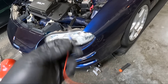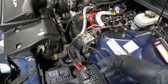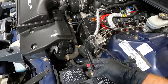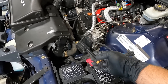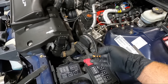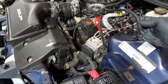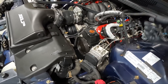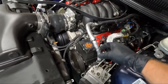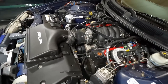We got it soldered back on. Turns out there was a tape joint right there, but anyway it's more sturdy now than it was — soldered and double heat-shrunk because it felt a little flimsy at the joint. We forced the lock back on and it's all looking good. I unplugged the O2 sensor down there to give me room to solder. Now we're going to thread the wire back down and hook up all the connections — IAT, mass airflow, throttle body, and so on.